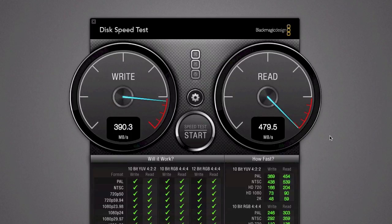I highly recommend the Samsung 830 — I've had no problems with it at all, no sleep-wake issues or anything similar. It's very easy to install in the MacBook and just as easy in a PC. It makes a huge difference to the overall operating system. The system also runs much cooler and much quieter because of no moving parts, and you're also looking at a battery life saving because SSDs draw much less power than hard drives. That was the Samsung 830 SSD installation into a 2012 MacBook Pro.